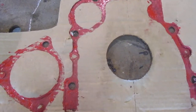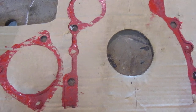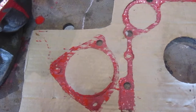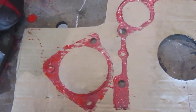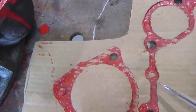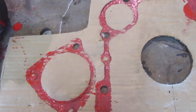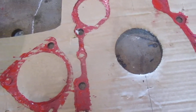So now I'll lay it out on my plate of steel, cut the holes, and once that plate is made, I will take my bell housing from my Chevrolet and lay it out on top. That will give me a reasonable idea of where everything lines up. The important holes right now are getting the bell housing holes and the dowel holes in the right place — the crankshaft hole is not that important at this point. It will be an issue in the future when I transfer the Chevrolet bell housing over to the Isuzu pattern. Any comments or suggestions, please send them.